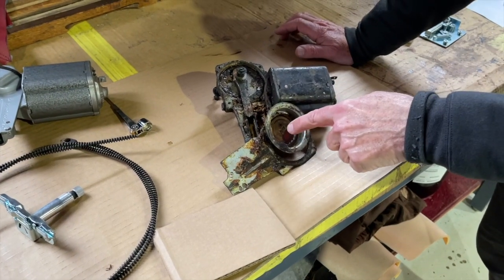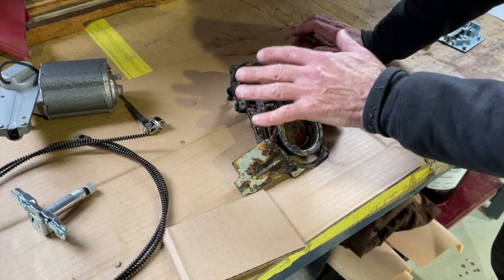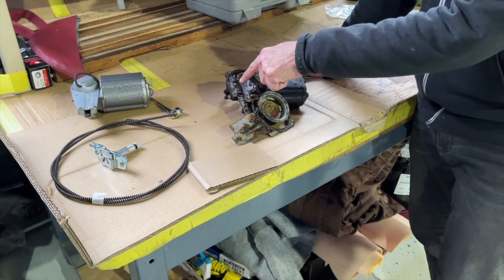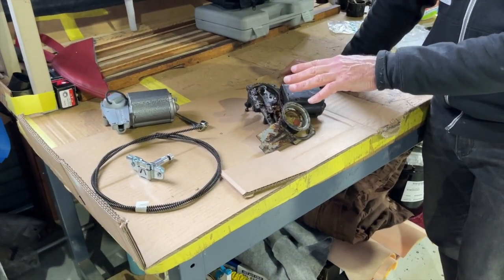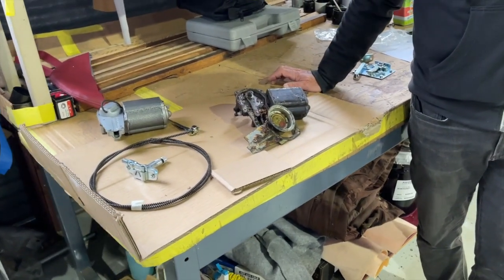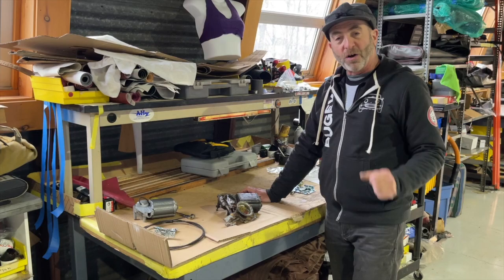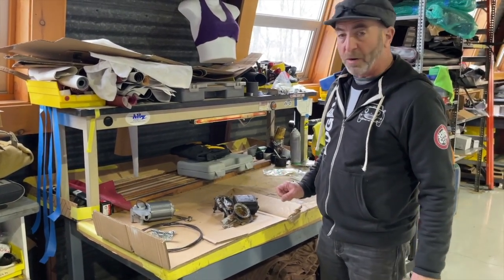Of course, these things don't always work. The grease gets wrapped around there, covers the whole thing. It gets very confused in a particularly greasy environment, or the probe gets dirty or bent or comes away from the gold disc, and you no longer have the parking function. And as a result, you have what we have in this red car, which is non-parking wipers. So you get to park them by yourself with the switch. And that's probably more than you need to know about parking.